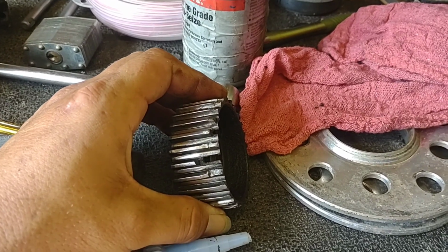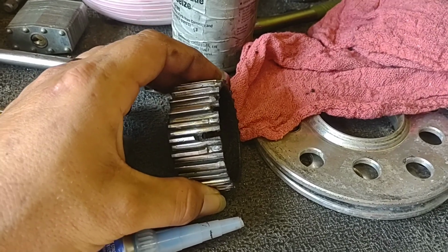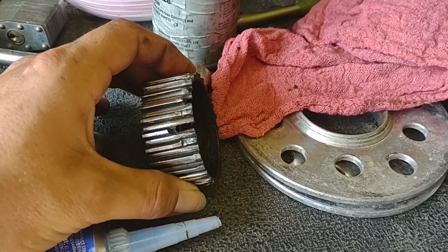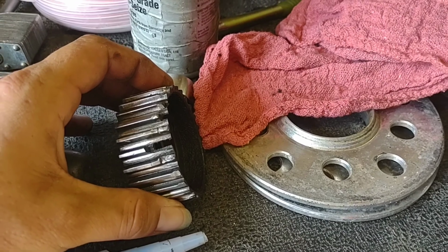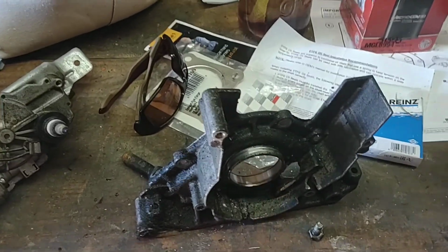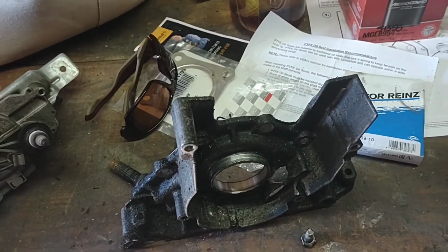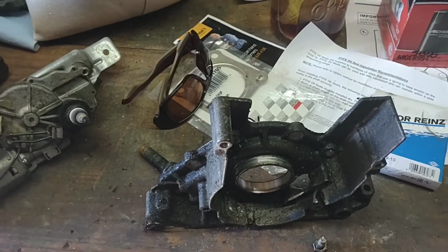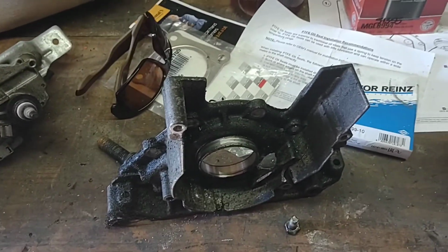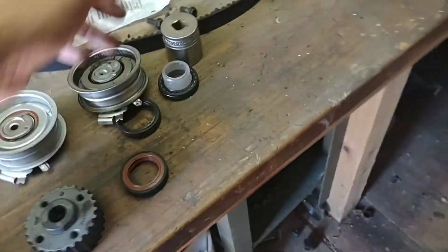It got wedged in there somehow up against the pulley, or this gear, and the gear kind of gave way, and the bolt went into the case, that case kind of gave way, and that's where that bolt got wedged in there. And so instead of it being the actual front main seal that was leaking, this hole was just allowing the sling from the crankshaft to just propel itself almost with force out of the bottom end of the engine. So I ordered the new part.